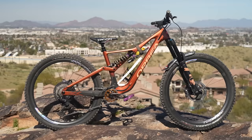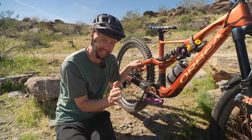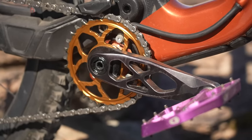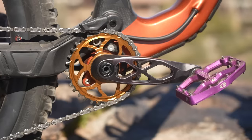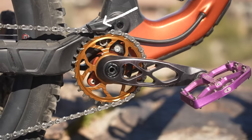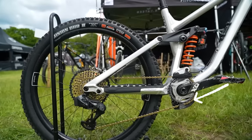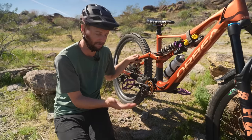Moving down to the belly of the beast — the drivetrain. Enduro riders, myself included, are running shorter cranks. These are 165mm on this bike, and the reason is fewer pedal strikes, cadence can be kept nice and high, and you're going to run quite a small chain ring as well — 32 to 34 is the norm. A lot of riders also use a little chain guide at the top to stop the chain from bouncing off. It can also be recommended, if it gets really rough and rocky, to run a bash guard bolting to the ISCG tabs to protect that chain ring from rock strikes.